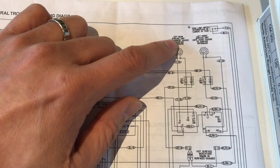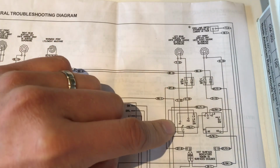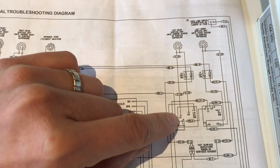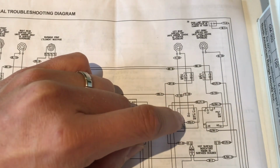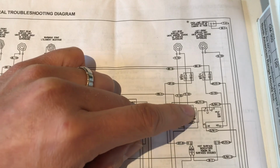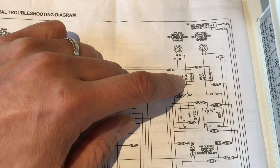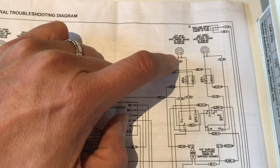This is your point of reference, the largest thing, the left rear surface unit. This coil, the resistive heating element. If you look down here, you see all these terminal points that were on the logical diagram. You've got H1, L1, H2, L2. Now what does this tell you? It tells you that this one switch unit is physically located in one spot, and it has H2, L2, H1, L1, and P all located on the same box, on the same unit, in the same location. And look here, 1A, 2A, that is the thermal limit switch. That's in a box all by itself, separated from the left rear surface unit heater itself.